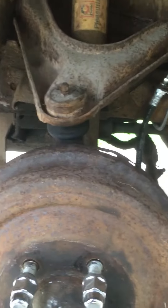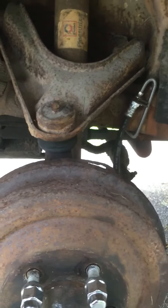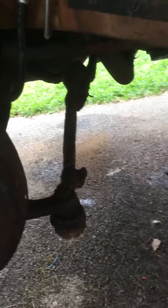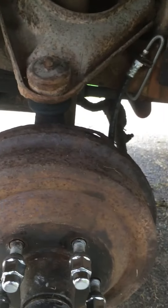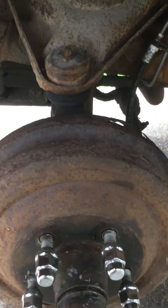So those are two little tricks I use to kind of get the car close to alignment. And same thing with the tie rod ends — I'll put together the new one and measure it to the old one so I can get the toe-in pretty close, and then I'll get it to the alignment shop and get the front end aligned. So that's my first tip for front-end rebuild Friday.